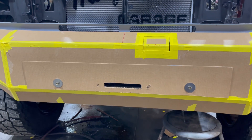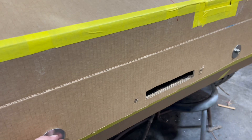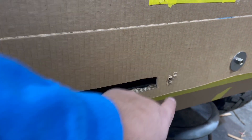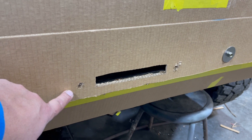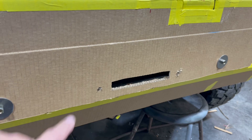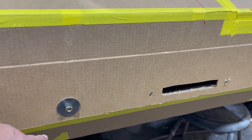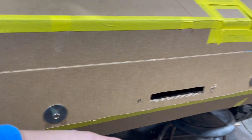I put a 40-by-six-inch piece of corrugated dead center. Right now there are two bolts that will hold this bumper to the truck — one here, one over there. This is where the fair lead will fit through, and these are the bolts for the fair lead. On the backside, the opening in the bracket that holds the winch is actually right at these bolt holes, so I'm going to open that up. This extra piece of plate is to strengthen the center of that bumper.